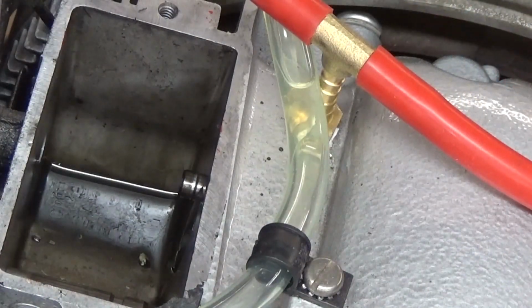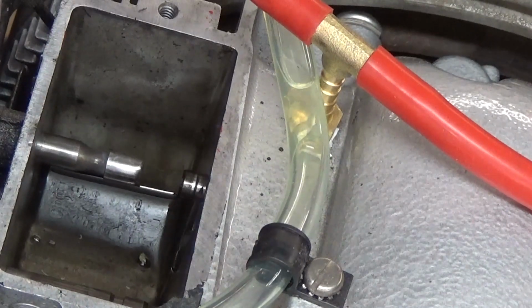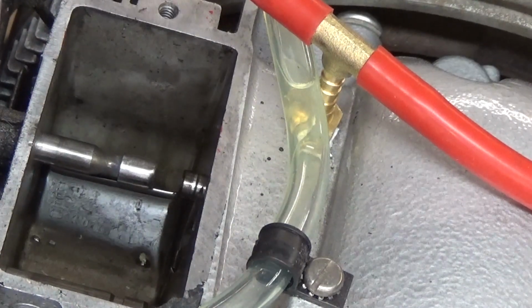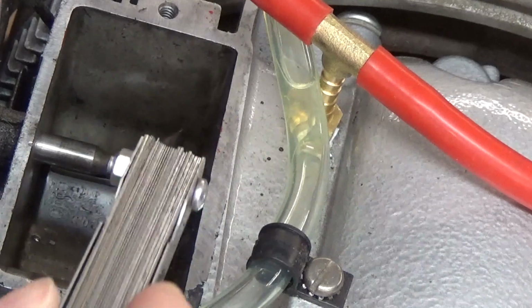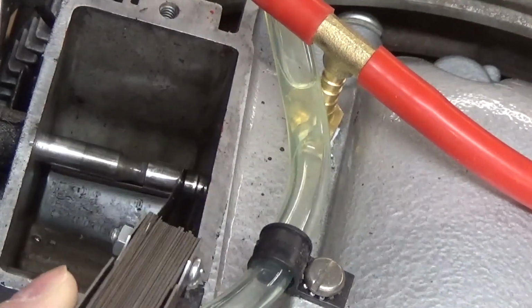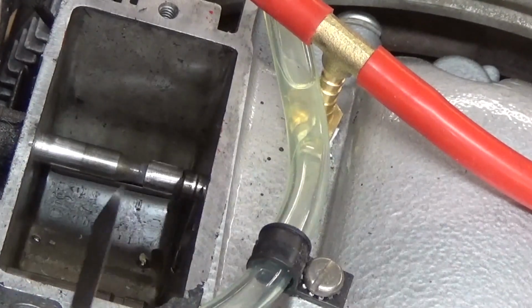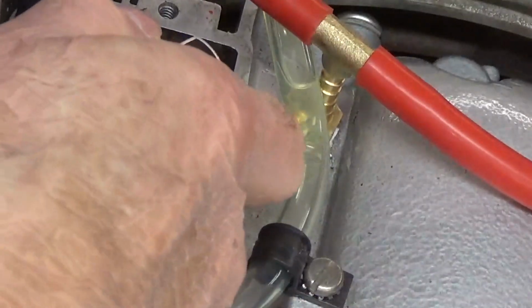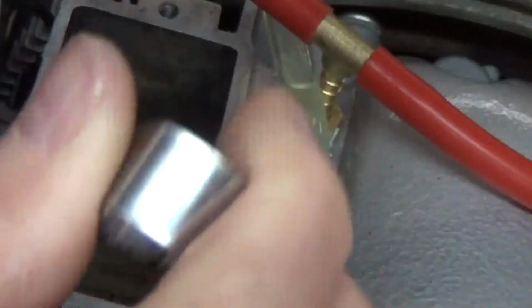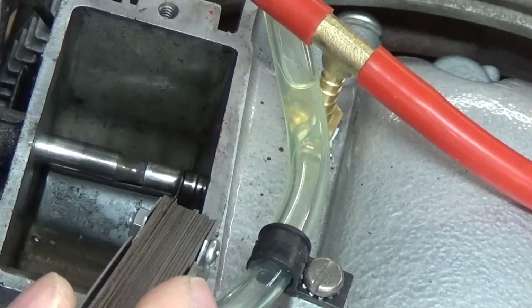I have seen different people wondering if you couldn't just add a little bit with weld. I haven't read of anybody actually doing it, and how it worked. So we're kind of experimenting here. Pushing the valve tight, and it still snaps, but it doesn't snap as loud as it did before, which means we still have a little bit more to take off. Stop shaking, George.